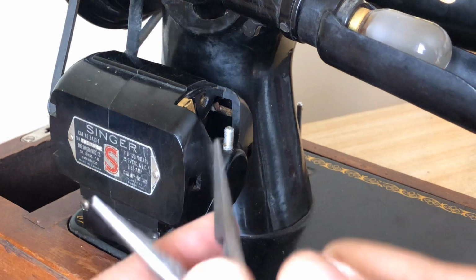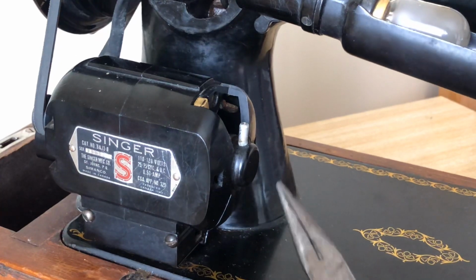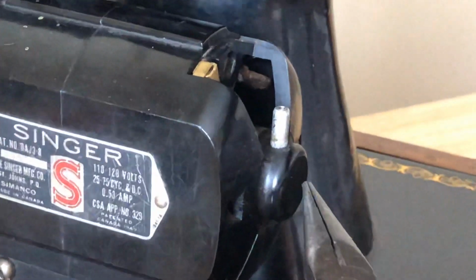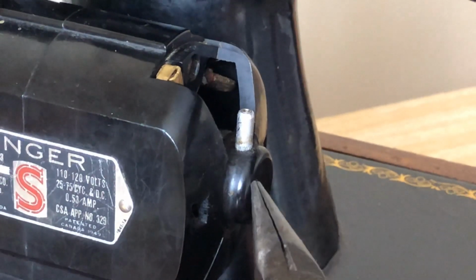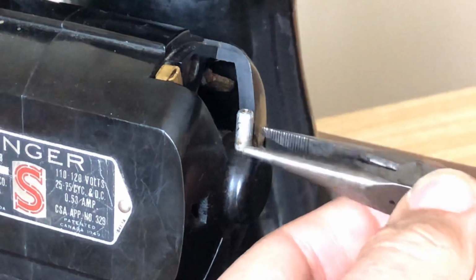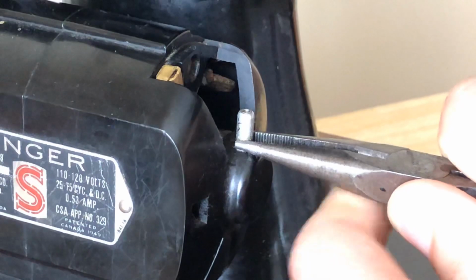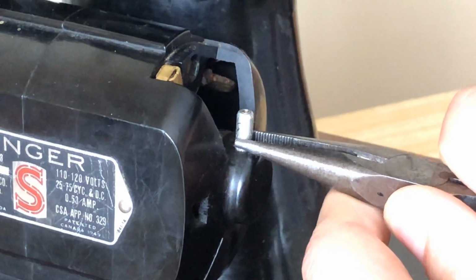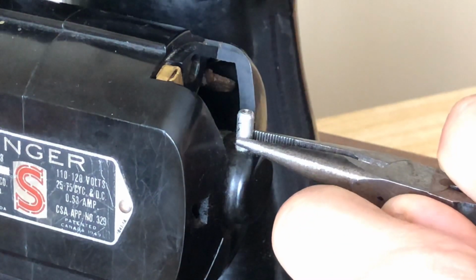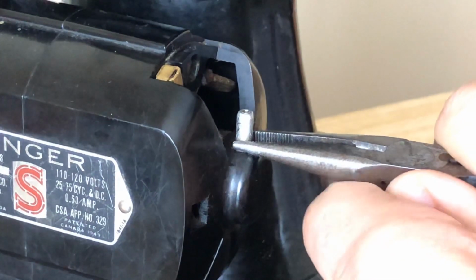So what I'm doing is, the needle nose pliers have some grip to them. And I'm going to turn this, because I'm behind the camera here. Let's make sure everything's getting into focus for you all. Now I'm going to take the pliers and grab it here, okay? I want to hold the pliers to it, but again, don't crush it because you could literally destroy it. What you want to do is get a grip on this little wick holder, and you're going to pull up. You only want to pull up. Do not twist it from side to side. It will make it more difficult to remove, and that'll make sense as soon as I get this out.